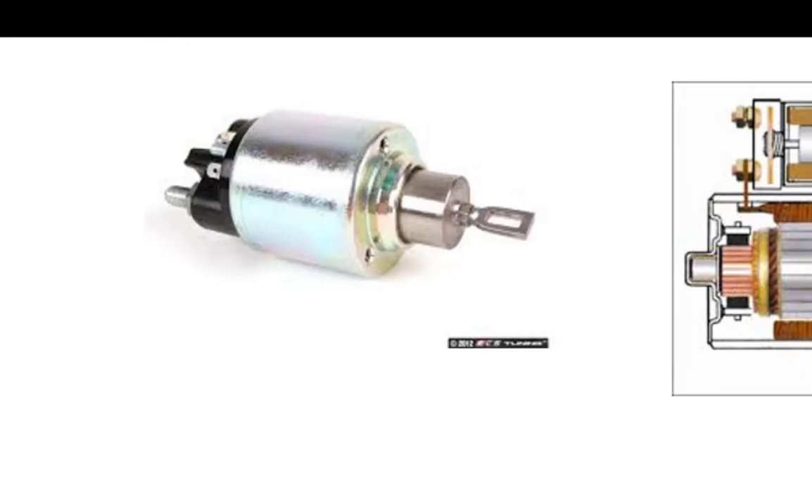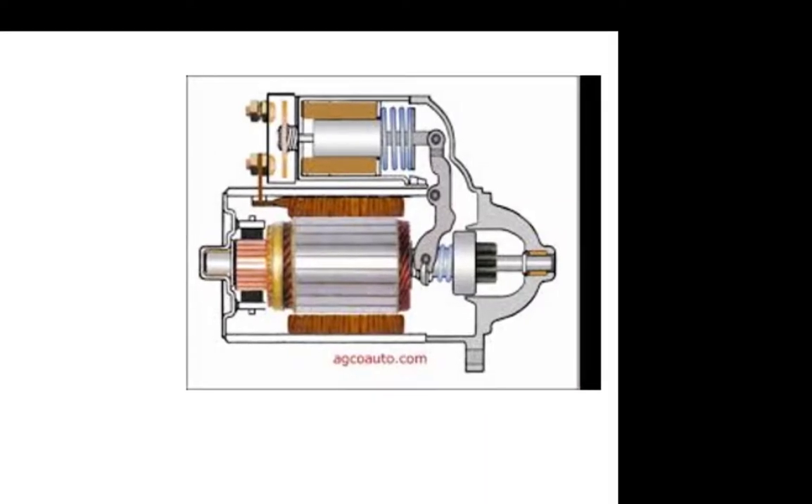The definition of a solenoid is we use magnetic force to create linear motion. If I send power to this solenoid it's going to create a magnetic field around the coil of wire; the armature is going to want to center itself in the magnetic field and pull in. The same thing happens with our starting solenoid — if I send power to the coil of wire it'll create a magnetic field pulling the armature into the center of the field. This pivots the shift fork causing the pinion to push out, which is how the starting motor engages and disengages from the engine. The armature also pushes on a pin which closes the contacts on an electrical switch — that is the definition of a magnetic switch: creating a magnetic field to close or open contacts in a switch.